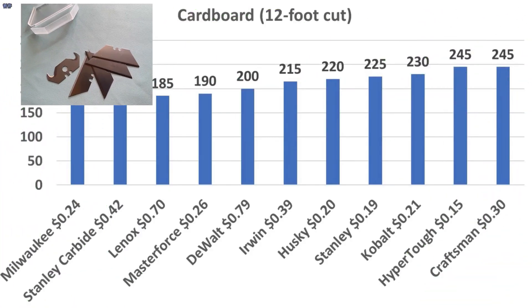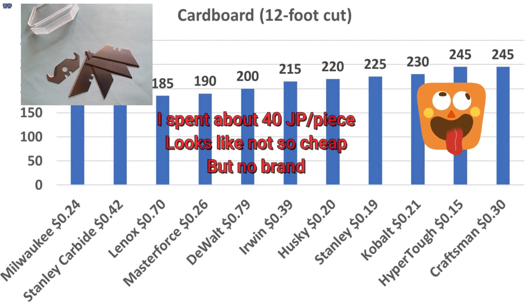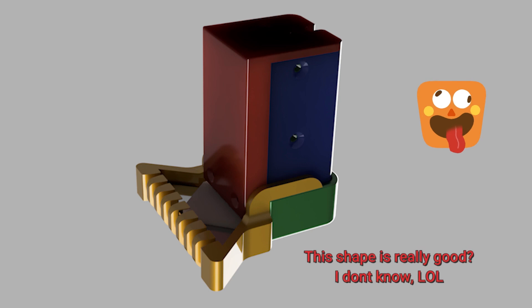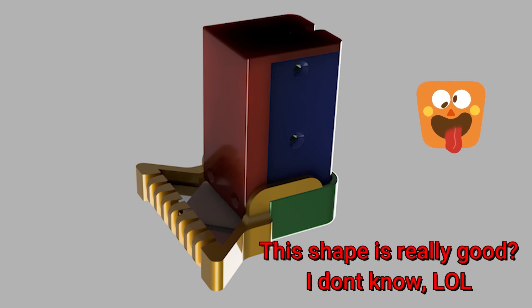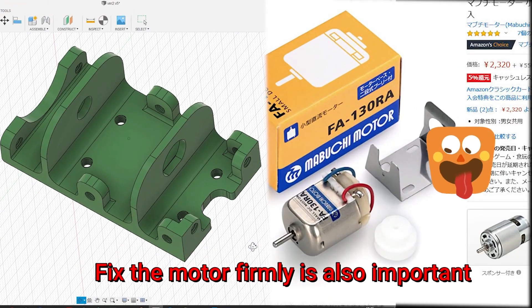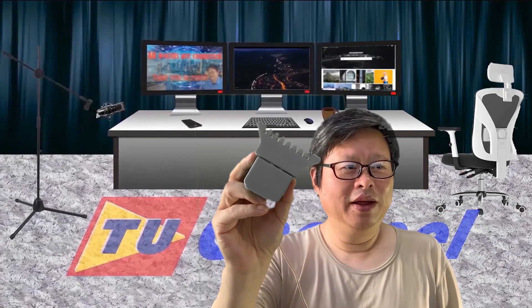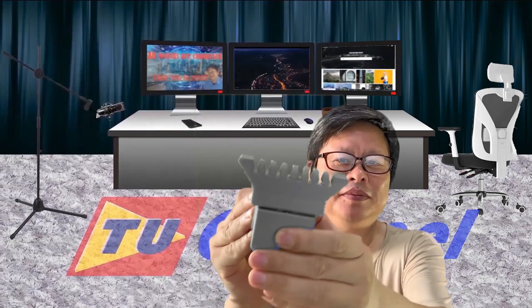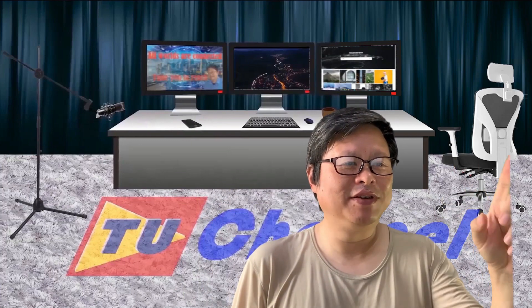The reasons are listed below in my opinion: first, the SK5 blade is not so sharp, however the price is very cheap; second, the hair cutter head cannot adjust its position to optimize placement; third, I should address the motor vibration since it decreases the driving force; and so on. Anyway, I already have some ideas to improve the performance. I will tell you the results in the next video.